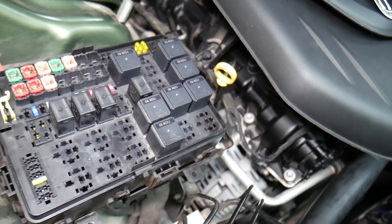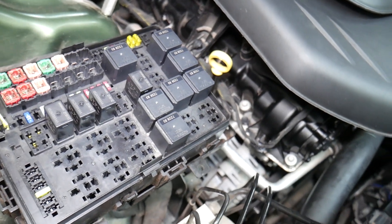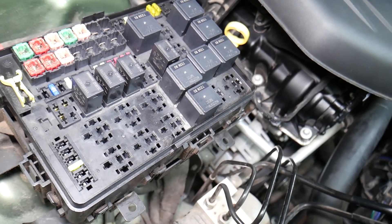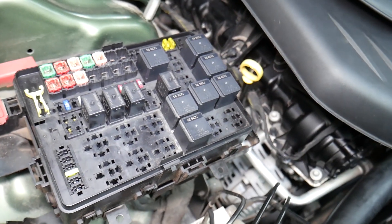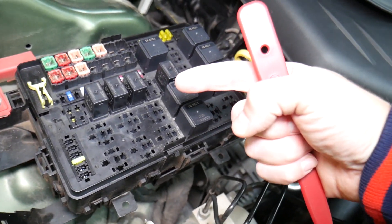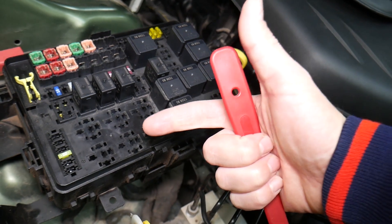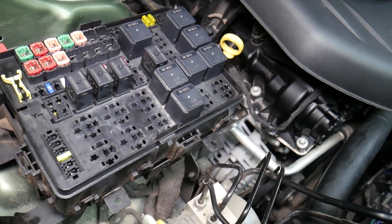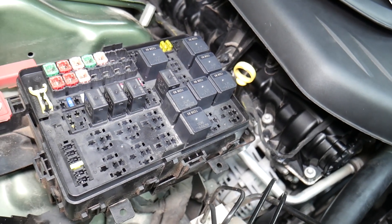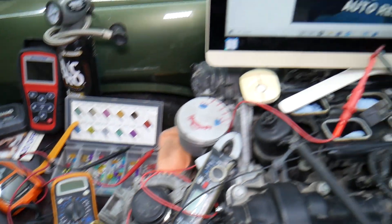For certain fuses, it's important to disconnect the car battery before removing them, otherwise you can burn the electronics. For instance, when working on airbag fuses, you need to wait at least one hour after disconnecting the battery — and if you're not qualified and certified to work on airbag systems, I would never recommend doing that. Also, a common mistake when disconnecting the battery is not knowing which terminal to disconnect and reconnect first. If you do it the wrong way, you can burn electronic modules — we actually burned a traction control module on a BMW that cost $2,000. We'll put a link in the description on which battery terminal to disconnect first.